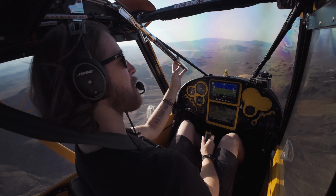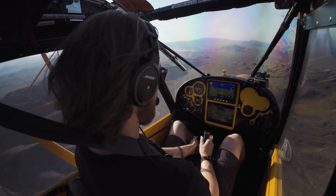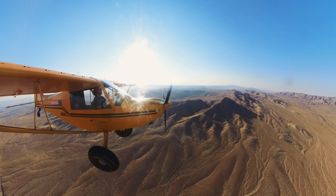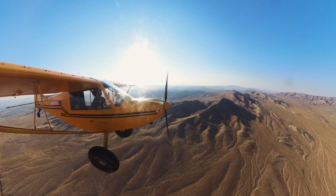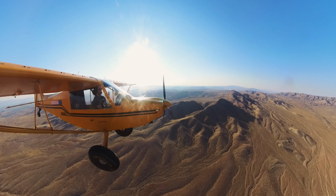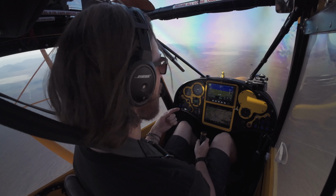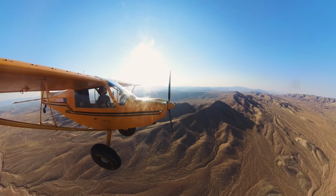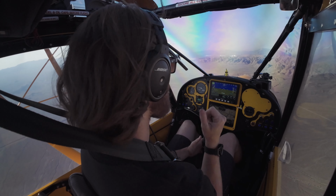And then I've got this Spitfire Concepts flap handle. The RANS has their flap handle down between the seats, and you're bending over, getting a hernia trying to pull your flaps. I put an 8-inch wide dual fork Matco tailwheel on, for better flotation on the tail. And the Matco wheel is attached to the T3 tailwheel shock system, which has been pretty nice when you drop it in. I redid the baggage compartment.